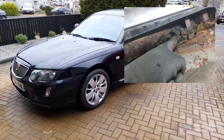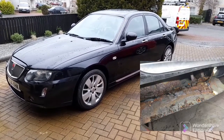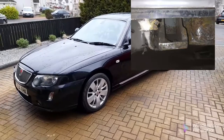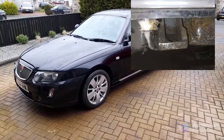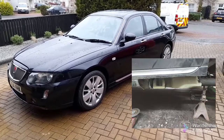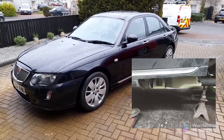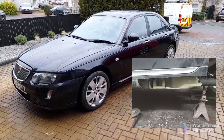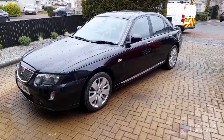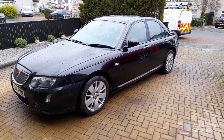What he said was — and I'll show you some pictures in the video — the basic design of the 75 sill causes water traps. There's a jacking point that plugs up into a hole in the sill between the inner and outer skin. There's no weld at all around the jacking point hole, and the inner part of the sill which folds underneath the car is only spot welded. There's also a grommet hole at the back of the sill behind the arch liner, so water gets in three different ways. Mud collects and when he cut off the outer sill it was full of water and muck, so he wanted to investigate why. He's also welded the inner arch.